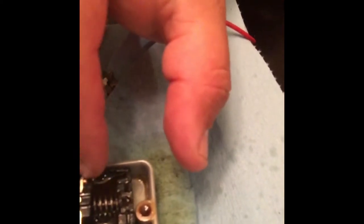So I got my friend and we basically took this guy apart. I pulled all the terminals out and cleaned them with a brass brush or a steel brush, and pulled these guys apart. This spring — one of the coils snapped off because it was so corroded, and this was all rusted, so it wouldn't even press down. Once I broke this loose and got the corrosion off, this small link between these terminals here wasn't actually moving when the accelerator switch went down.